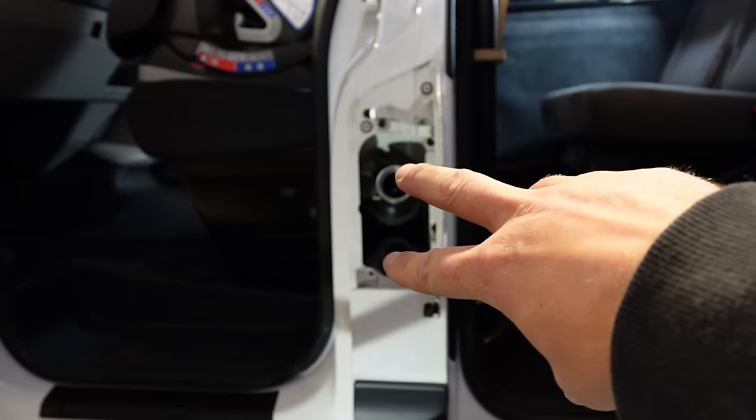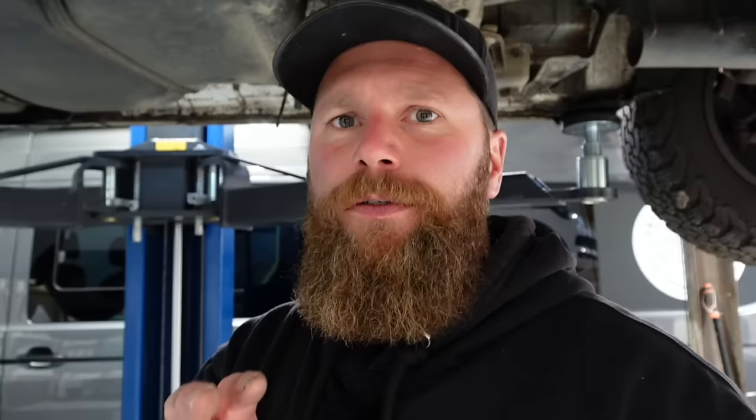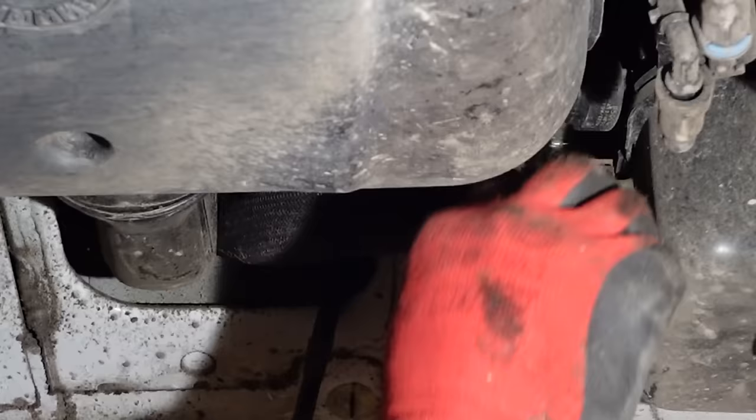There are some 10mm bolts - basically you're relieving anything holding those fillers to your vehicle. The ad blue tank doesn't have to be removed, but the ad blue pipe on ad blue vehicles is totally in the way when trying to remove the diesel filler tube that passes through the same part of the vehicle. The only part we're actually removing is the filler neck to the ad blue because it's in the way.